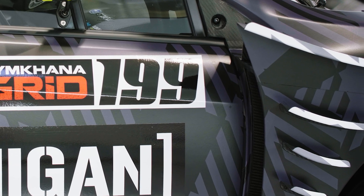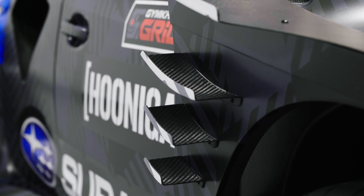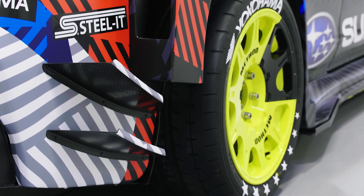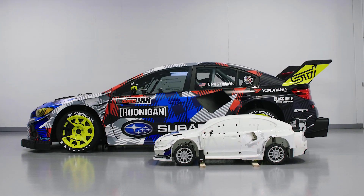Down the sides of the fenders there are also additional aero winglets. They're intended not only for straight-line downforce — they're intended for when the car is sliding. The air is applied to the side as a side force, but then we also contain that air and we create more downforce.